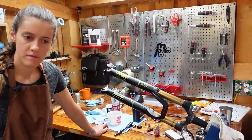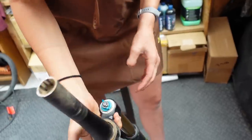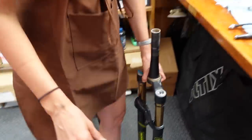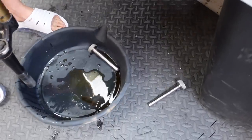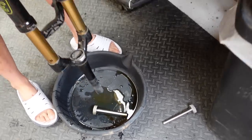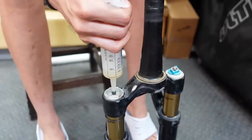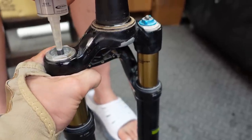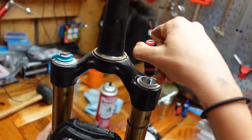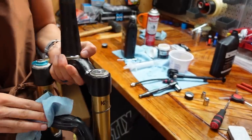There should be 15 cc's of float fluid — Fox 5 weight suspension fluid — in the top of the air chamber. Let all the air out and then use the valve core remover to remove the valve. Turn the fork upside down and compress it so any oil in there ejects. In fact there was no oil in there — good thing we're going to add some. Inject 15 cc's, hold the fork down, press down, and let go — it sucks it right in. Valve core back in. Put it on the ground and compress it a couple of times — it feels like butter. All we need to do now is put the air back in and set all the settings.